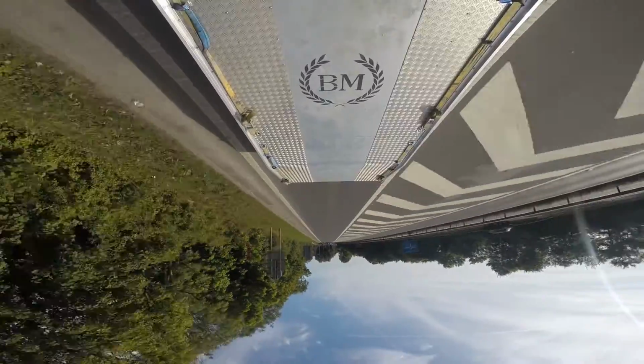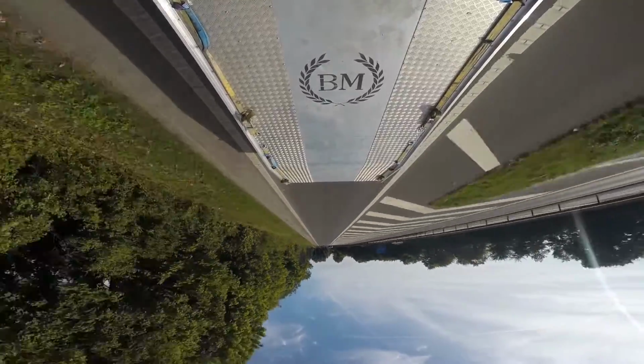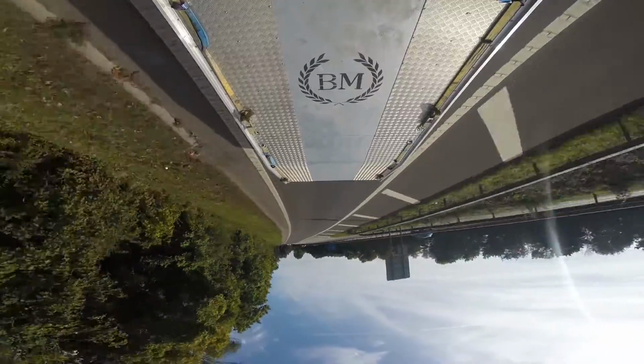So if we're going to our maximum weight of say 1.3 tons or something, which would be about the same today, I might go up to about 4 bar on the gauge here, and I can just press that in here. If I'm going along and I'm feeling a bit too bouncy, I can put a bit more air in there, and it'll firm us up to smooth out the bumps.